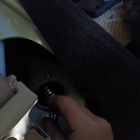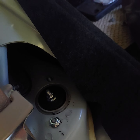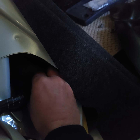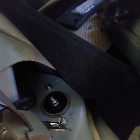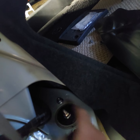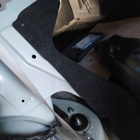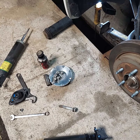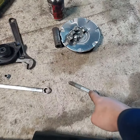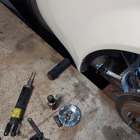You can see the shock is holding itself up. Spin a nut on there, then the other nut — spin that on there. You kind of have to use a swivel socket to get to that back one because it's underneath that body bracket. Then just stick that bottom bolt in there and crank it tight, and we'll go underneath real quick and have a look.